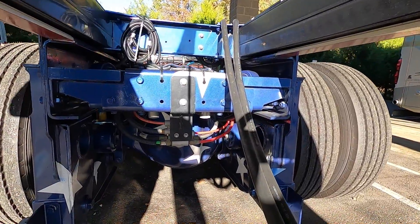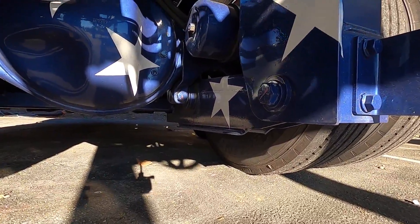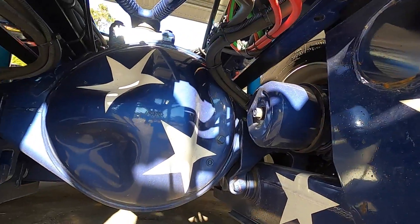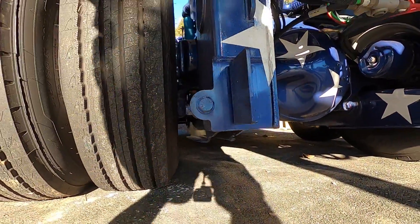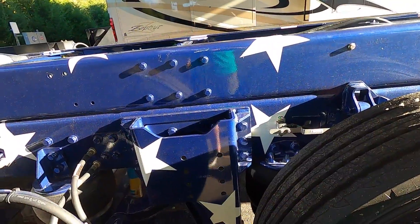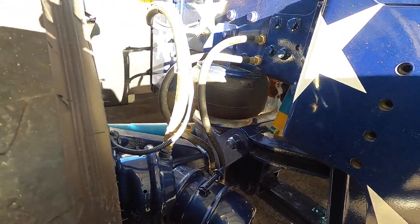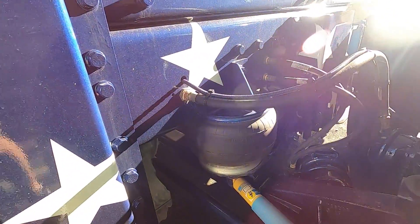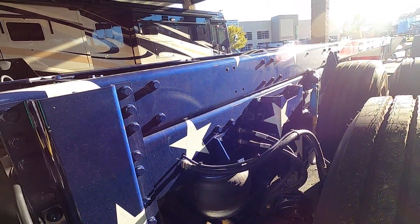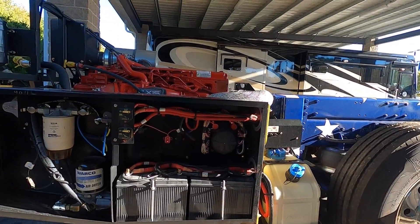Here's a great shot to remember next time you're thinking about driving in grass or mud — every time you go off of asphalt, gravel, or concrete, this is the ground clearance you're compromising. You'll see some canisters attached to the linkage there — that's the mechanism that locks the tag axle in place when you're going forward above a certain speed, preventing them from flopping around. It's only when you're going very slow that those canisters unlock and allow the rear tag axle to swivel.